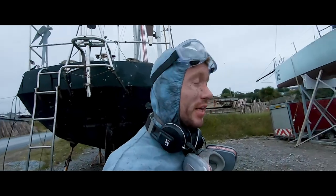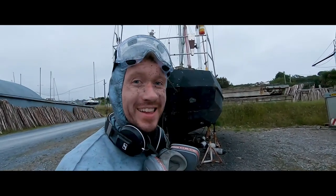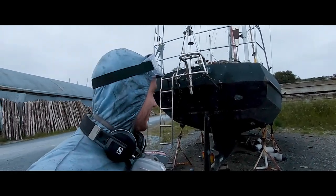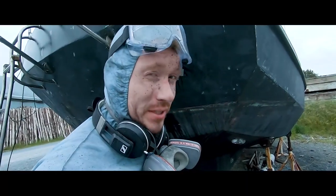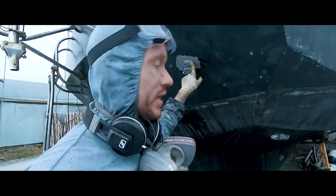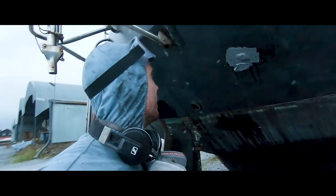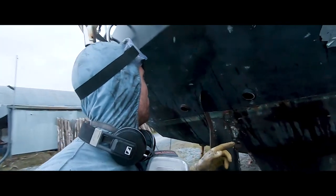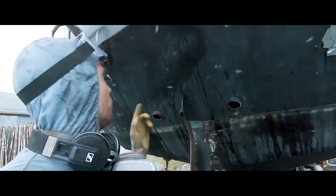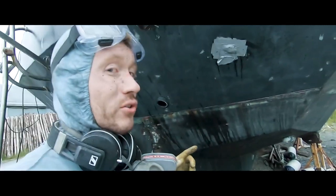So there you have it — Friday evening, and the first pass on the transom is done. That's all the topside done. I did manage to take off the expired primer using just the sander and sandpaper, which is good because I don't have a grinder on hand. So that piece is done. Right now there are only certain other elements to take back — just one small rust section there. I'll open that up again and make sure there's nothing concerning lying underneath.